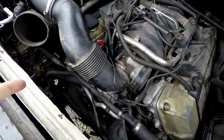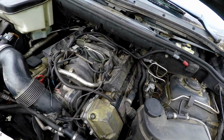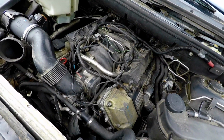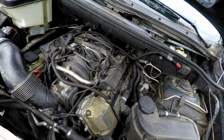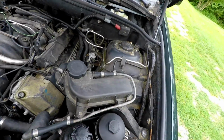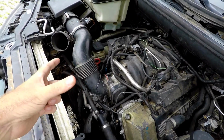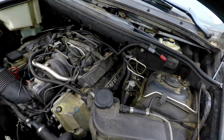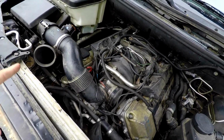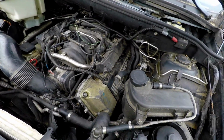This thing does have chatter the first 2 or 3 seconds when you start it, like they all do. It does not have the upgraded timing chain tensioner. But you know what we found out? The upgraded timing chain tensioner doesn't really fix that. So I'm not really sure what's going on with that. What it is, when you first start it, it takes a second for that tensioner to pump up full of oil, and it chatters a little bit. So I don't know. Some guys are stacking washers and stuff in there. That's something that Greg can mess around with. That's not going to hurt it from driving. That's only on the cold start for about the first 2 or 3 seconds, if even.